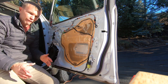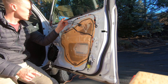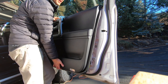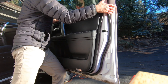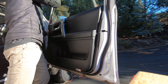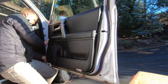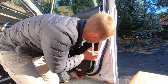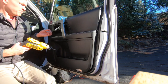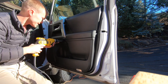Next step is we've got to grab that door panel again. Before we put it back in, we want to make sure that we connect these connections — and again these two — making sure we leave the green on the bottom, white on the top. Once we've got all of those connected, we want to push in this top piece first and then we'll push in the bottom. Push progressively across the top until you hear it snap into place, and then likewise we'll just go down the sides, push the sides in place, and then we'll get the bottom last. Just like that, it's installed. Then we've got to reinstall these three screws. The thing I love about this installation is that it's just as easy as the instructions make it look.